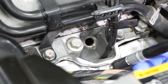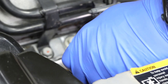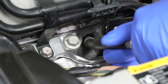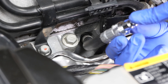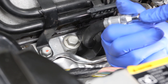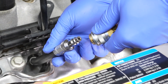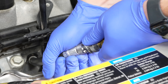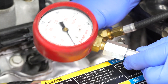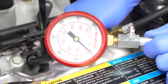So we're going to take our threaded adapter piece and put it onto our spark plug threads — make sure it's not cross-threaded; it's really easy to do, especially with aluminum. There's no special tool needed because the end of the adapter is knurled, so you just put it on finger tight. Then we grab our gauge — it's just like an air hose line. Pull back on this collet and insert it firmly into our adapter piece, and make sure it doesn't come apart. And then we have our gauge ready for cranking to show us how much PSI the cylinder is generating.